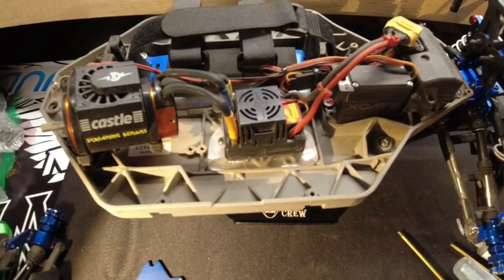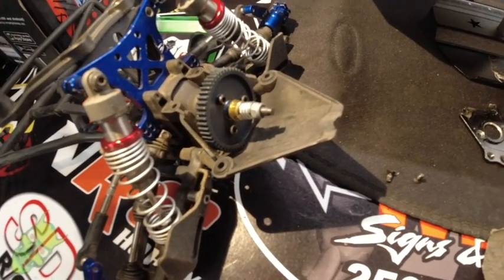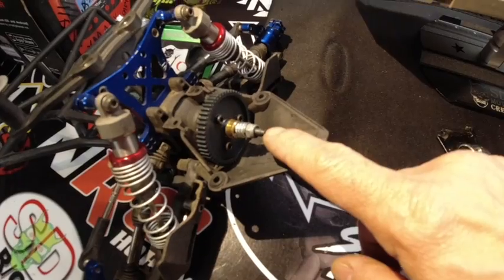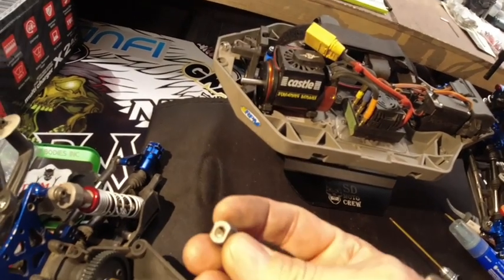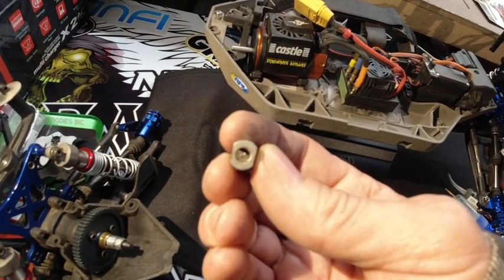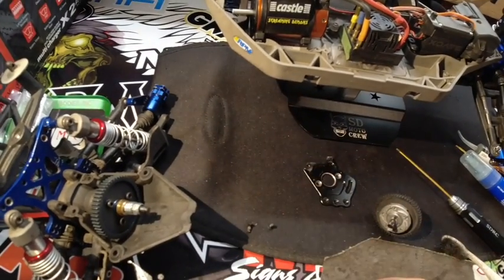If you're watching this video, give me a thumbs up and don't forget to subscribe if you enjoyed the video. I was just about to put this all back together when I realized that last time I used the slash, a gear that sits on the end of the shaft had come loose. I looked in there and sure enough, it was stuck down in the end of the chassis right where that bearing is. Unfortunately, down the center of there — where there should be nothing — was the broken slipper clutch spur gear shaft.